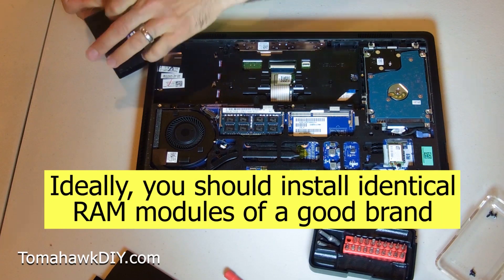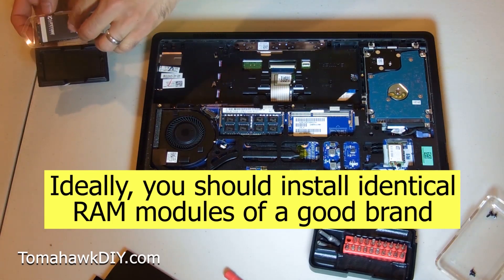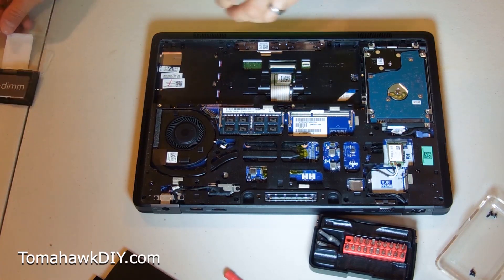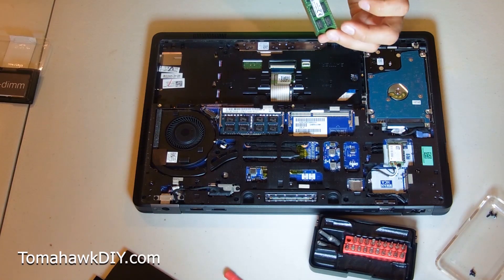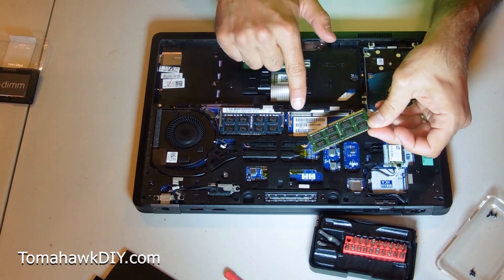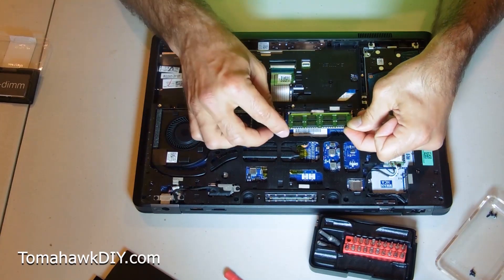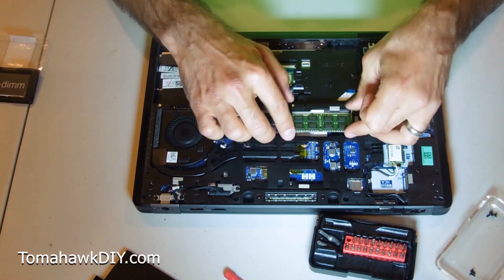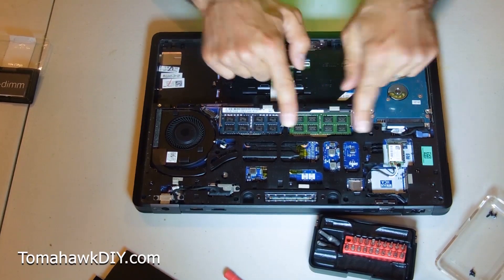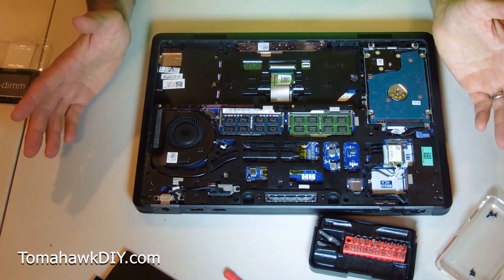I was a little bit lazy — I ordered a separate eight-gig chip that is from a different manufacturer. This is Kingston RAM. You should make sure you're getting some reputable RAM. We'll slide it in here. You can see all the pins that line up right here. Slide it in just like that. Push down. There you have it — went from eight to 16 gigs. Pretty easy.